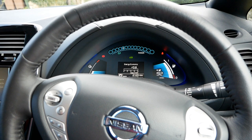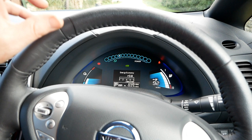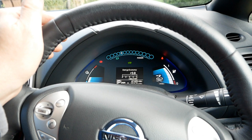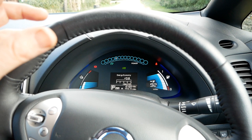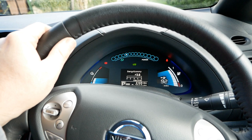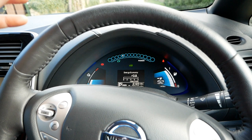With an EV, when coming up to a bend, traffic lights, or roundabout, read the road ahead and lift off the accelerator to coast — while coasting you're slowing down and charging the battery. Do that as much as possible to put energy back into the battery pack and extend your range. If you just slam on the brakes it's fine, but you'll do fewer miles per kilowatt hour and you'll wear your brake pads, losing energy as friction and heat rather than putting it back in the battery. To get good range, drive a little more gently, read the road ahead, and use regen to slow you down rather than the brakes.